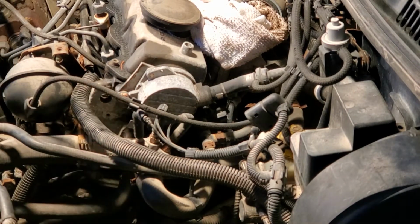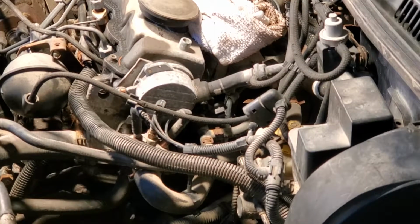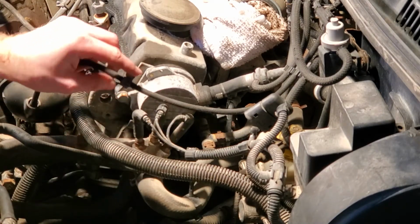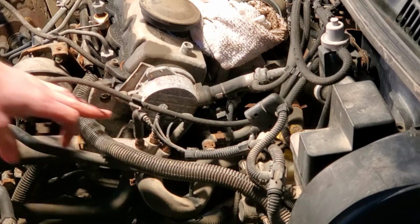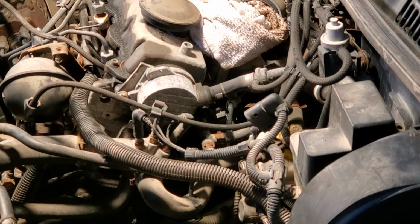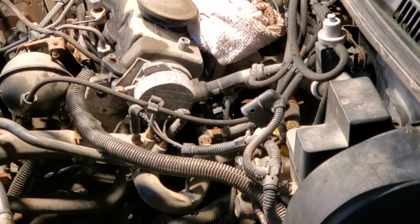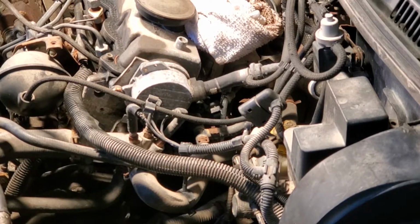All we're successfully doing is turning the head, which I'm not interested in doing either. I don't think maybe this was supposed to be clipped on. This clip that's supposed to be on this end of that little bracket tab is broken anyway, so I think what I might just do is bend the tab back out of the way so I can get a box end wrench on it. It's not ideal, but I can't think of anything else that I have here that I could use to get on that.